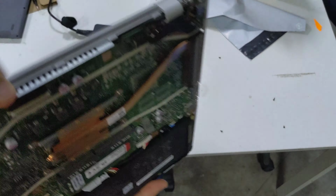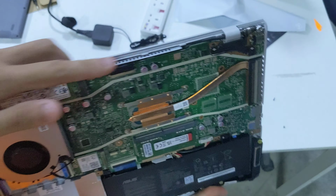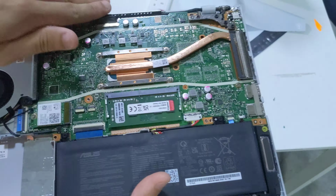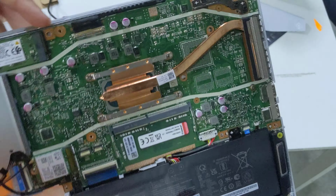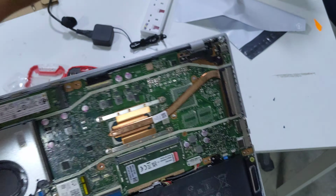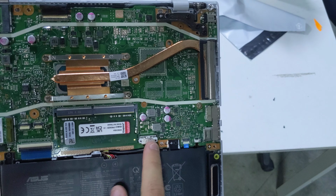You can see there is kind of like perforations at the top here, which lines up with the perforations on this, but these are not punched out here. As far as you can tell, they're not used here for cooling. And presumably, if you actually punch out the holes on the bottom case, they won't actually make the cooling better, because this is a computer where the airflow is very important to go across the motherboard. And if you have holes at the back, it's going to disperse the air, and CPU performance will likely cripple. Your battery connector's there.